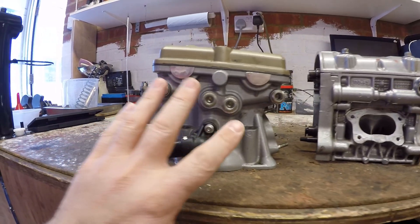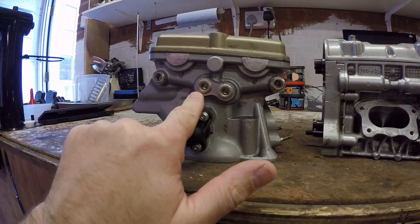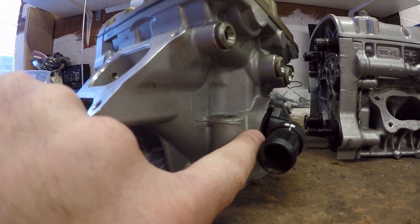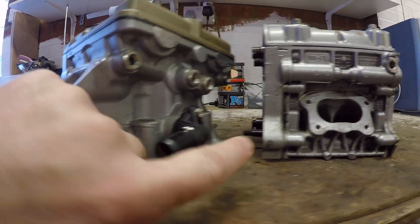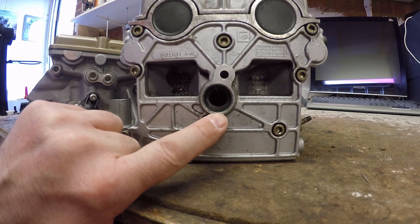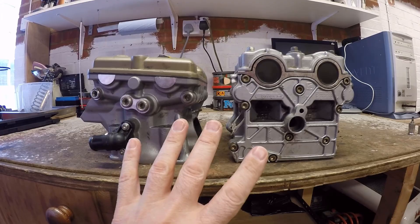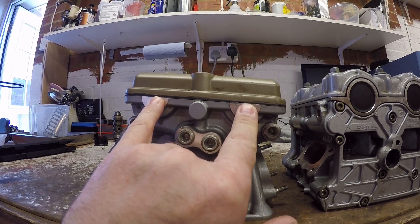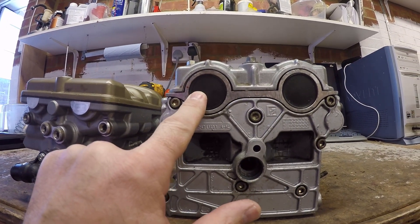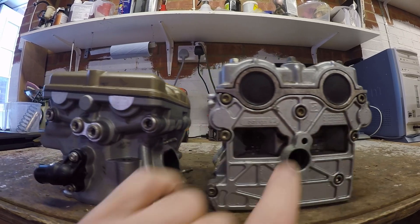On the later engine it's a single casting and the pins are directly accessible through little bolts that act as covers. The waterway is straight cast, then machined flat with a connector, whereas on the triple nine head the water connection is actually part of the external cover. There are also no cam seals exposed on the later head, whereas the earlier engine has rubber cam seals — which is a slight weakness, as it's another point of potential failure.